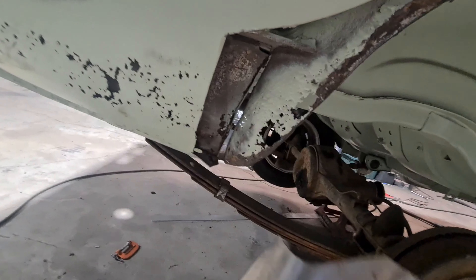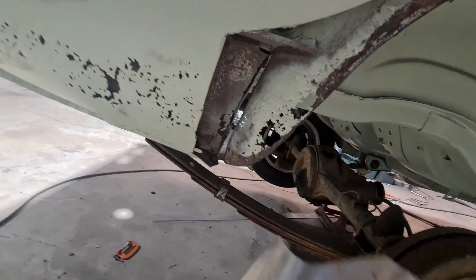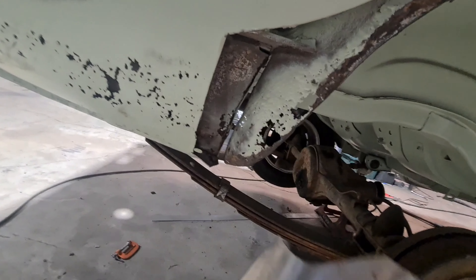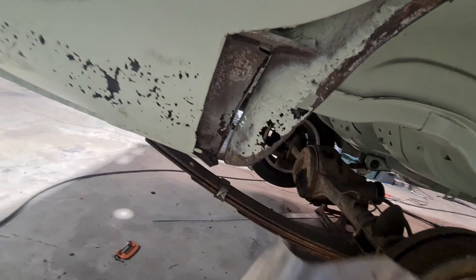With the weld I use a wire brush first to get it clean, then knock it down with a 36 roller, and once I get it to a certain point I switch to an 80 disc which is much finer, then start hammering it up. After the 80 on the roll lock, get the hammer and dolly and dress up any areas you can feel, then use a block to show all the little lows you've got to pick up. Progressively keep going — give it another block, dress up wherever needed until you're happy with it. Gave it a buzz with the 80 and primer will get any little imperfections. Buzzed all the plug welds off and now using the spot welder to put spots on to make it look factory over the MIG welds.